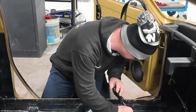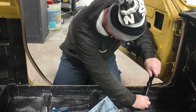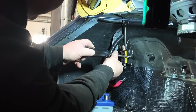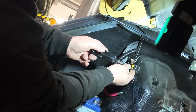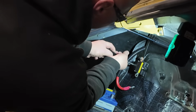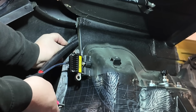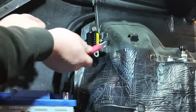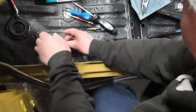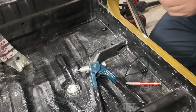So battery isolators now in at the back there, and Anthony's been running the main battery cable. So we're running an ECU master isolator, which has a couple of useful functions. Obviously, the primary one being you can isolate the battery, and that's done with a push button at the front. But we can also monitor overall current draw on the system near the battery, and that can be transmitted via CAN bus to the ECU or the PDM. So you can do programming in either engine ECU or PDM that might, for instance, knock out some of the non-essential electrical systems when the overall current draw is too high. Also, there's an overall safety on there, effectively like having a big fuse on the battery, so if it goes over a preset current, however many 100 amps, it just kills it so you don't fry your battery cable.